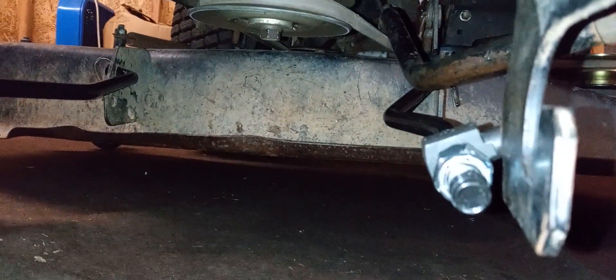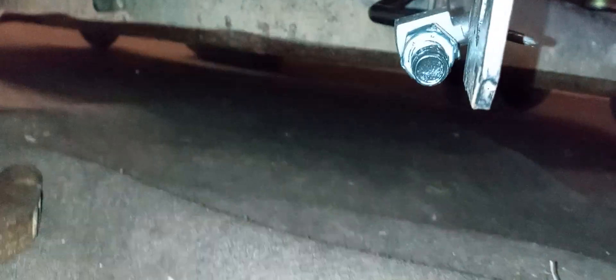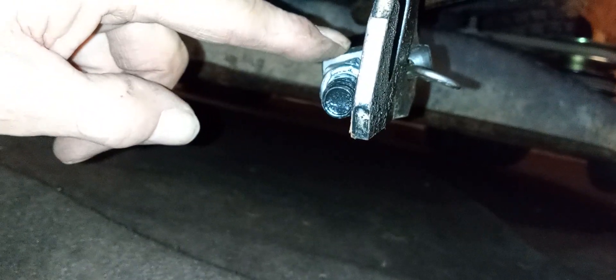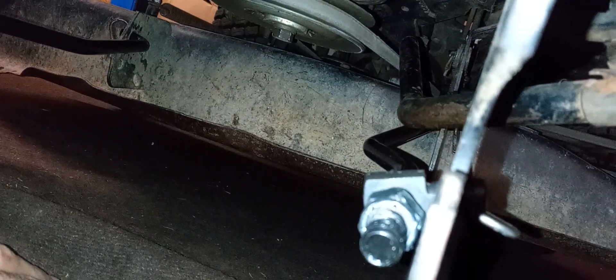I would have filmed this, but this is a tedious process. Just make sure that you put everything back in place. If you had to, use the original hairpins, because the new hairpins that came with this are a little bit thicker than they need to be. Otherwise, you'd have to drill out the hole in both this piece right here and the other end going down to hold the actual mold pan up.